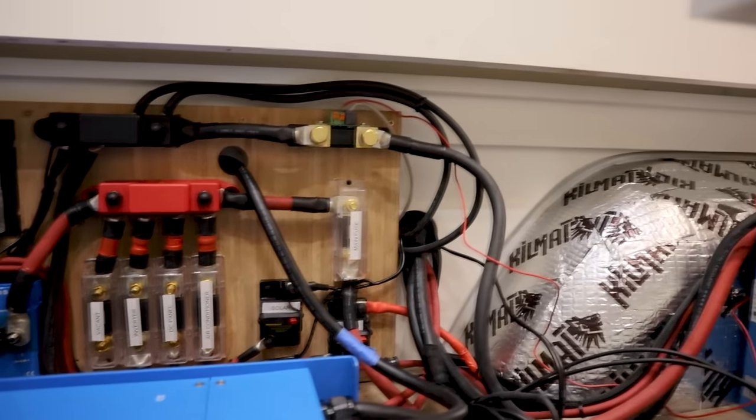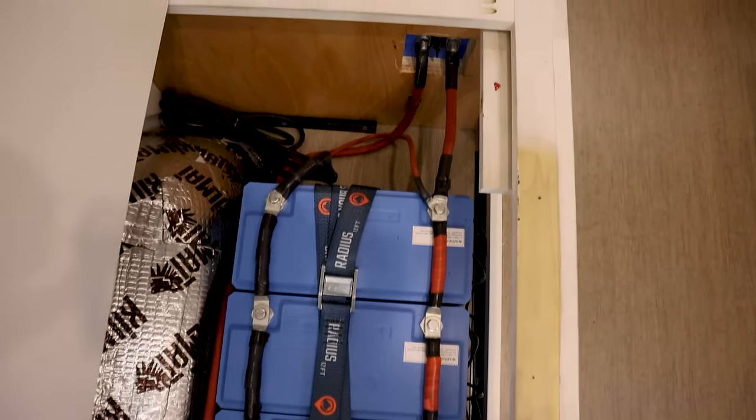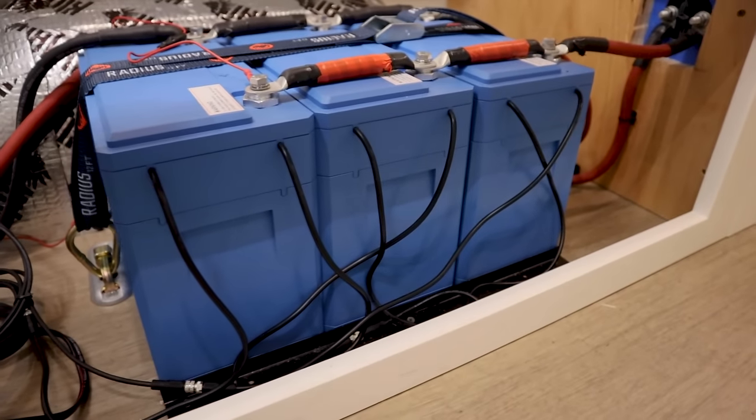I have seen it spike all the way up to 60 amps when you first turn it on, especially if it's hot out. If you put it on eco mode and turn down the fans, you'll get a longer life out of the batteries since it's only running at about 30 amps. As a point of reference, this particular van has 600 amp-hours of lithium battery power. Even at full blast pulling 60 amps, we should be able to get 10 hours out of the batteries running the air conditioner at full speed. Once it's cooled down, you'd typically turn it down to eco mode, so pulling 30 amps, you could get 12 to potentially 15 hours if the batteries were completely full.